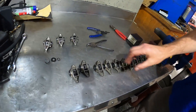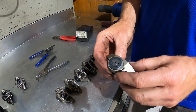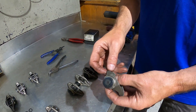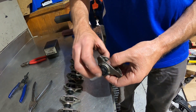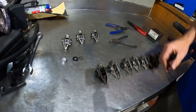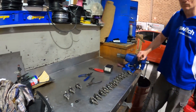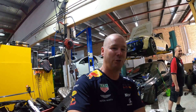That's a secret car over there — you can see some nice specky bits when you come out here to Gentech. That thing's just pumped out 500 at the tyres and it's still got more in it, so stay tuned. Alright Frankie, you're done — good job mate. Don't need to go and spend 900 bucks in the US, do you? These are a great little trick — to seat these circlips you just have to have the little bearing seated down far enough into the rocker body so there's a little bit of play with your washer, then crack those clips on. Some tapping on the end seats them and then they should move nice and smoothly. This is preventative maintenance for our track L77 we're building, so next step is a cam — and given we're going with Brian Tooley for the trunnion upgrade, I think we're up for a Brian Tooley cam. Woohoo!